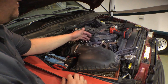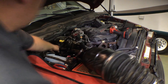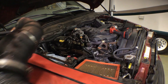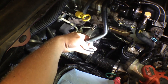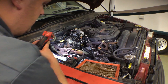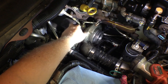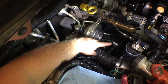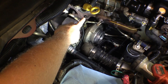We've gone ahead and disconnected the mass airflow sensor and the intake air temp sensor, and disconnected the hose that connects the crankcase ventilation system to the air intake. So we're going to set the air box out of the way. Once that's out of the way you can see we've got our breather line, which we can set to the side. Using a flashlight you can see down by the turbo: our oil supply line, our electrical connectors, our coolant supply line — all of those are going to get disconnected, as well as the outlet boot, the exhaust clamp, a couple of electrical connectors, and the studs from the exhaust manifold. Then this thing's ready to come out.